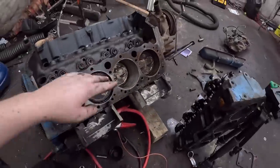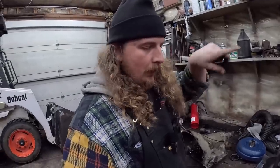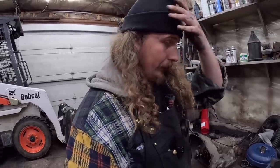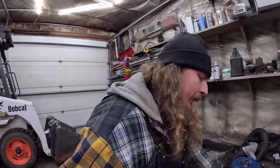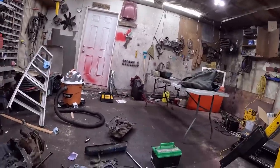And you know what I'll probably do now, because we want to make sure this is good. I was holding the drill, honing it, not moving up and down very much. You really want to go up and down, up and down. Watch someone else's video, for the love of God, if you're going to be doing this. And that's how you want your crosshatch. So I'll just go ahead and touch that up real quick with some in and outs, and we'll move on to the cylinder head and machine that on the bench.